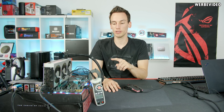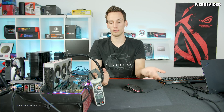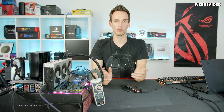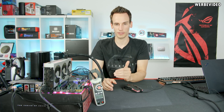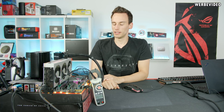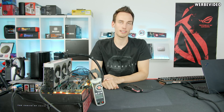Until I realized the date in my OS was set to the year 2191. That's what happens every time I get engineering boards that haven't been connected to the internet — they aren't synchronized with time and date. I don't use internet on my test benches, so they can't auto-sync. For whatever reason, if your date is higher than the year 2077, Windows 10 cannot install drivers anymore — it feels like the Y2K thing. Every single time it takes me one or two hours and then I realize the date is set to 2191.